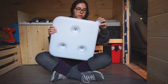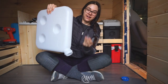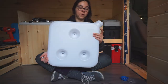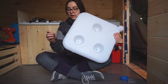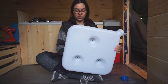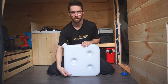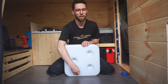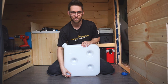This is the diesel container — we were worried we didn't have the screws for it but they're inside. It will be mounted to the wall above our heater. We need to drill a hole at the bottom of the tank, about an inch above the very bottom, so the diesel can flow out. The outtake has to be near the bottom, but not all the way at the bottom, because debris and sediment can accumulate there and we don't want that getting sucked through the tube to clog the filter and pump. So we're installing it about an inch above the bottom.